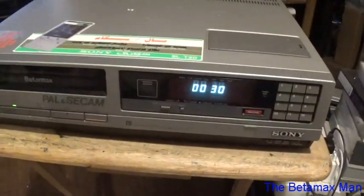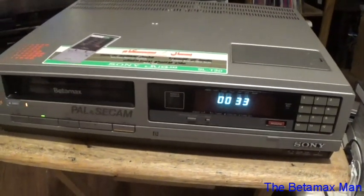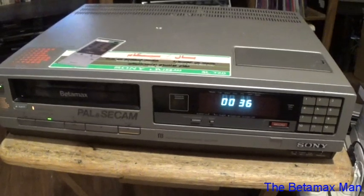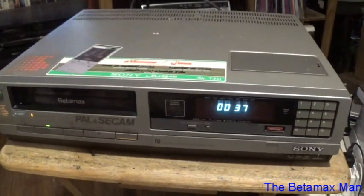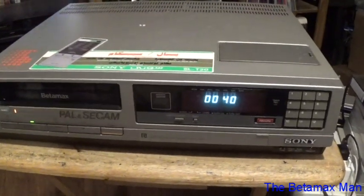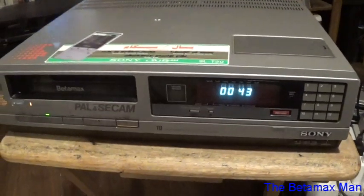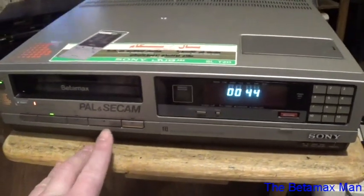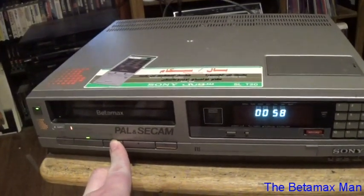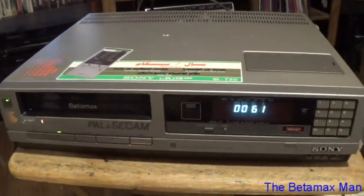This thing was working — he said it did play tapes, which it did. But it did have an issue where it was eating tapes, and also when you would put fast forward on it was chewing up the tape because it wasn't sucking the tape back in fast enough. The motor was basically shot, or maybe that IC had failed. But I don't have any crinkling of the tape anymore — works really good.